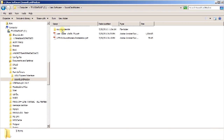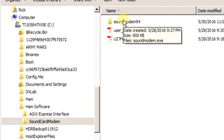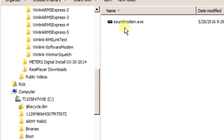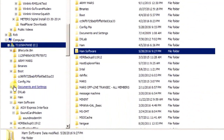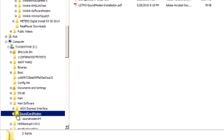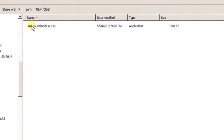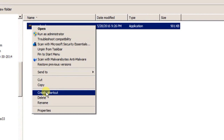You should now have three files: the Sound Modem folder (with a version number), the user guide, and the installation instructions. The downloaded file is a zip — unzip it to get the folder. Inside is just an executable program; there's no installation process. It can go anywhere on your computer. I placed mine on my C drive in a folder called 'ham software,' with a 'sound card modem' subfolder. Once placed, right-click and create a desktop shortcut so you can easily start the program.